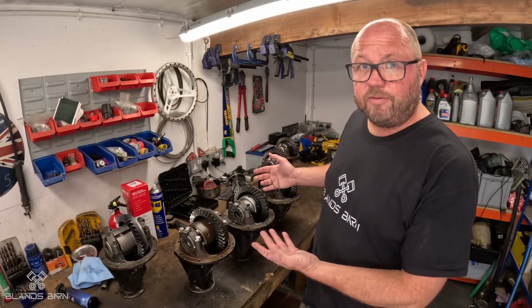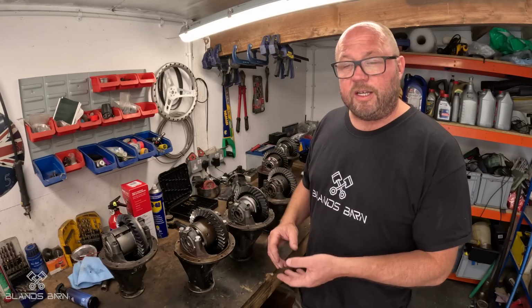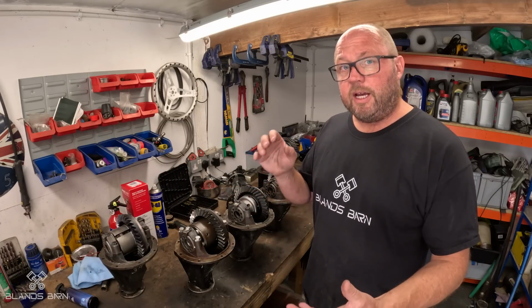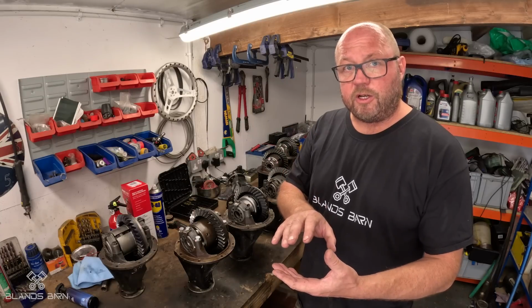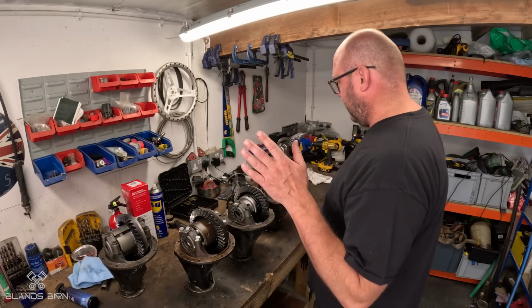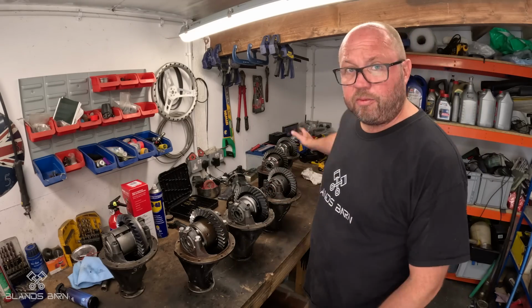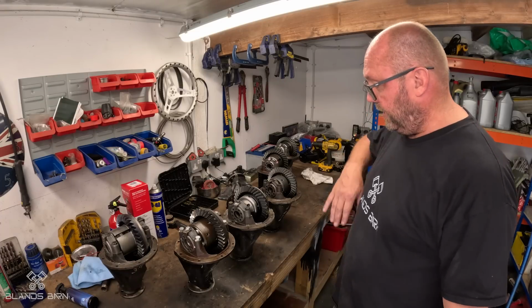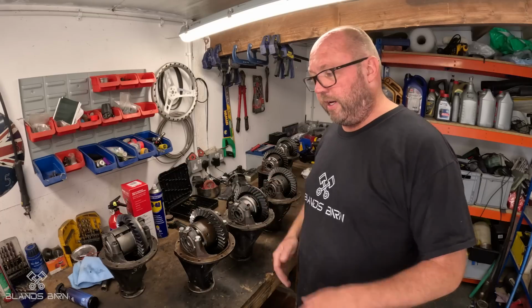But given the cost of these now, and given the rarity, and given the slightly more modern gearboxes from the old days, it's actually just as easy and a lot cheaper to run one differential and change the gear ratios for each track. There's actually 3 different ratios here. There's a 3.9, 3.7 and 3.5. So 3.5 are on the faster tracks, then you go to a 3.7 on a slightly slower track, and then you go with 3.9 on the smallest tracks.